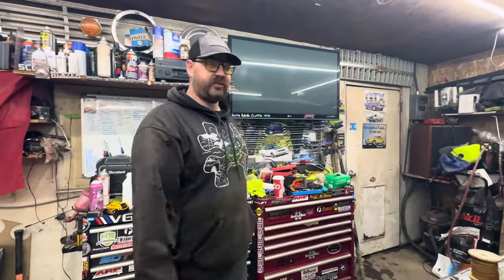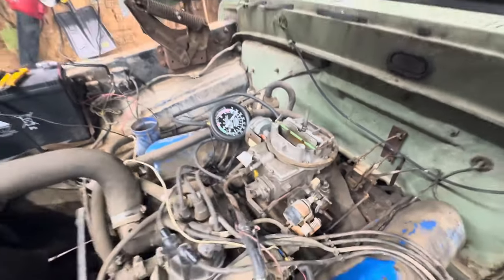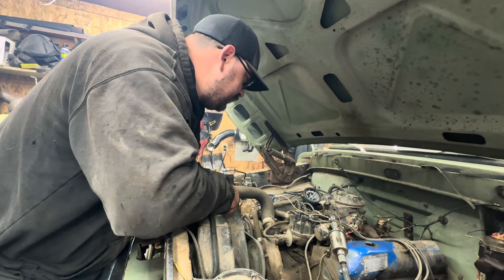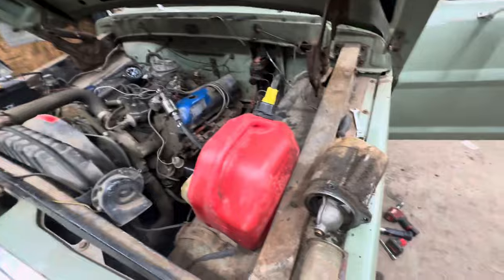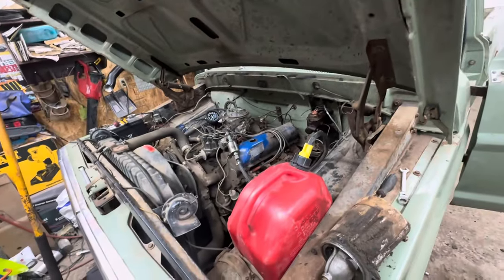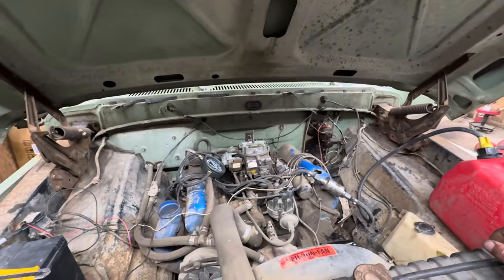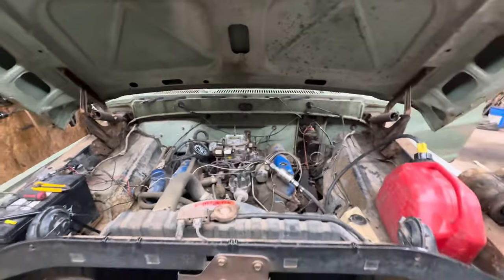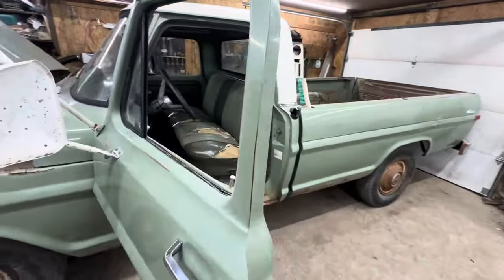Chugging, just pouring fuel everywhere in there. She's just soaked. It's gross, dumping fuel. So I had to pull the carb back off and figure out what power valve's supposed to be in there. I'm gonna order one. Starter's changed. It's cranking. It's running. But I still need a power valve. It's running so bad. If I need a power valve, then it's stuck valves in the motor, but...